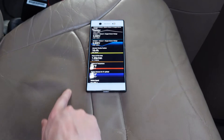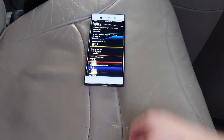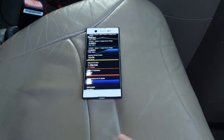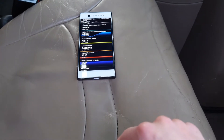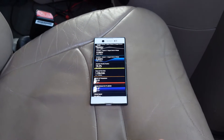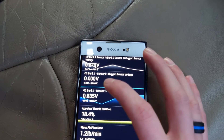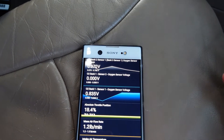The way the exhaust works, there's a pipe that goes from the passenger's side of the engine straight down to the back, and there's a pipe that goes off the driver's side all the way down to the back, and they join together. So Bank 2 Sensor 1 is the first sensor on the driver's side, and Bank 1 Sensor 1 is the first sensor on the passenger's side. The sensor all the way in the back is still on Bank 1 - the passenger's side - but it's the second sensor, so it's Sensor 2. That's why your computer shows Bank 1 Sensor 2 with no voltage.